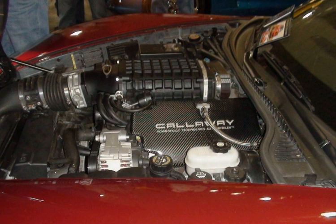The Vortec 5300 LM7 was introduced in 1999. The stock cam specs at 0.050 lift are: 190–191 degrees duration, 0.466/0.457 lift, 114 LSA, 112–116 timing. The Vortec 5300 L59 is a flexible fuel version of the LM7. The 2002–2003 made 285 hp and 320 pound-feet, while the 2004–2007 L59s made 295 hp and 335 pound-feet (454 Nm).